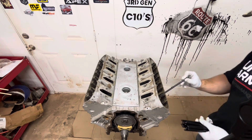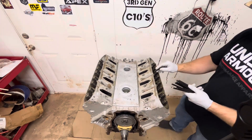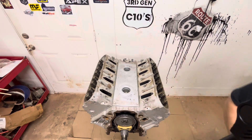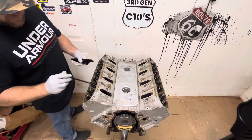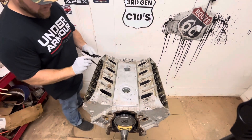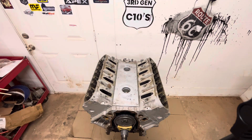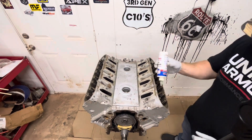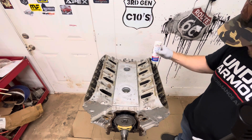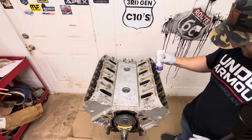To get started, we're just going to get our push rods installed in each intake and exhaust of all eight cylinders. I've already cleaned up these push rods, got the factory oil assembly lube off of them. We'll just get them all installed. We will put some assembly lube on the tips of each valve and then each push rod tip as well, so that way we have nothing dry on startup.